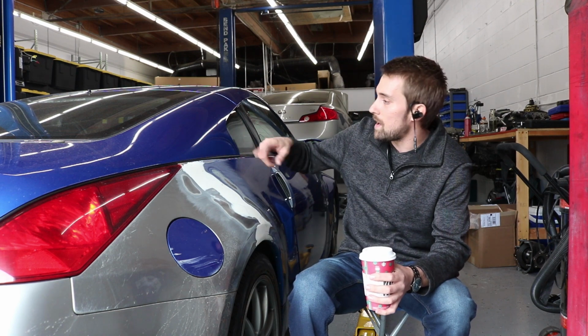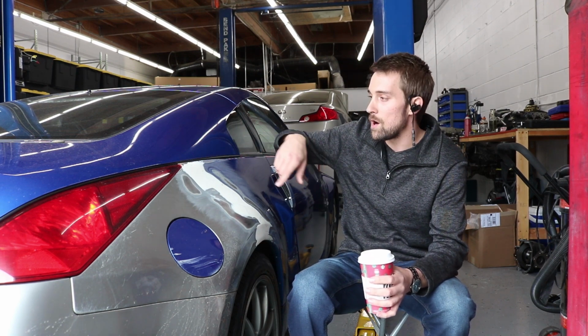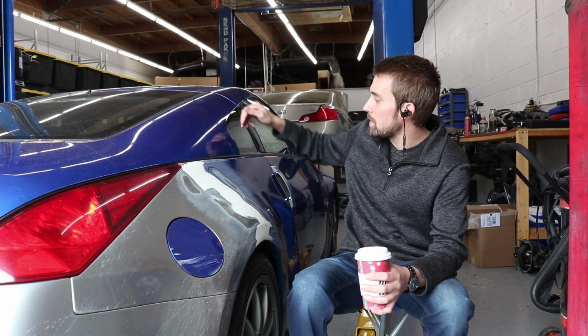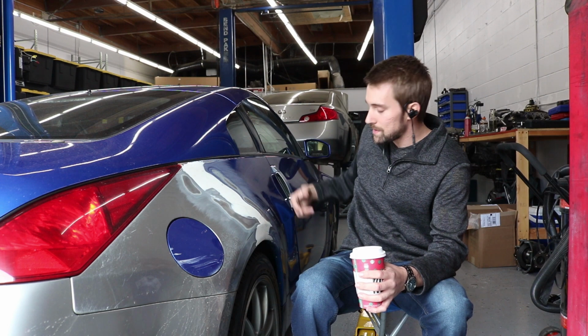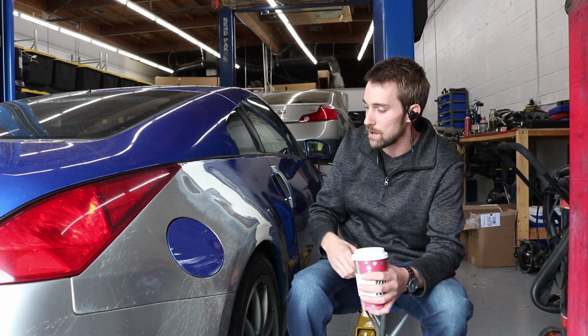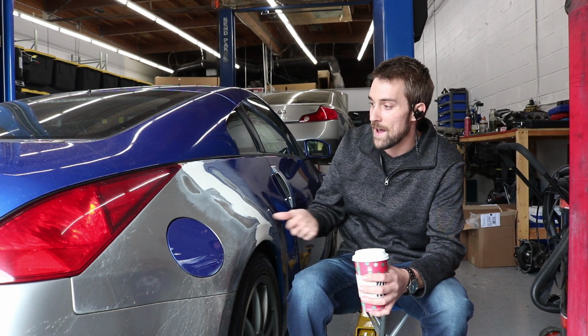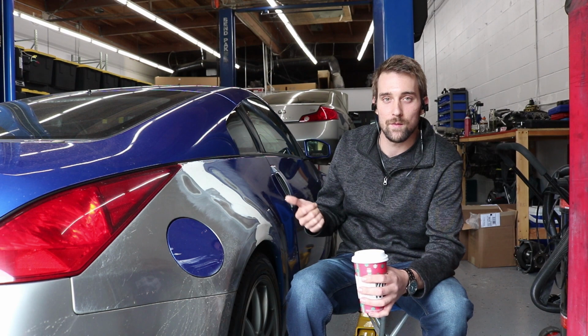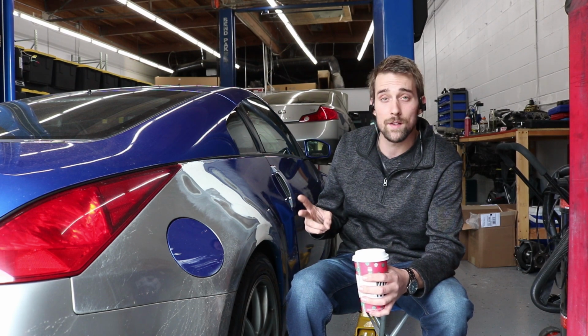So I went through with a guy that I know, and we drilled out all the spot welds. We cut it about up here, we moved this window and replaced, we pulled this whole skin out first. We put it on the frame machine and pulled it out first. And now I've smacked it while having fun in my car 2 more times after that.